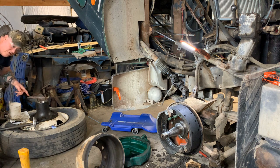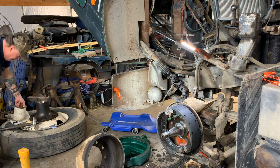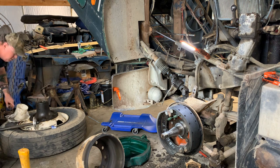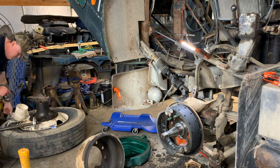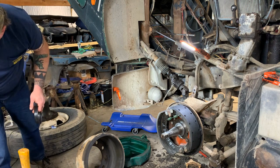So we're going to install the seal and we'll install the hub. Very important. We cleaned our bearings and we re-oiled our bearings with all new 90 weight. Throw that in there. Don't forget to put the bearing in. I know you'd say, that could never happen. Bet me.